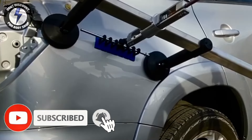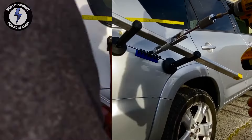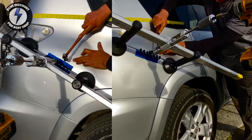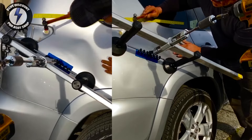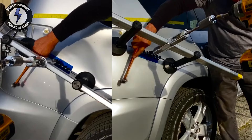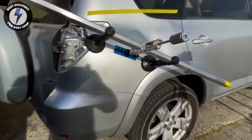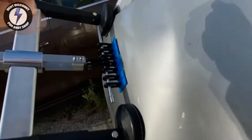With the remaining pressure of the puller, I am going after the crown. The toughest section of the dent is now gone. I'm doing a little more knockdown with my blending hammer, tapping down the crown using light controlled hits. Now taking a closer look — the line in the body line is restored and the crown is down.